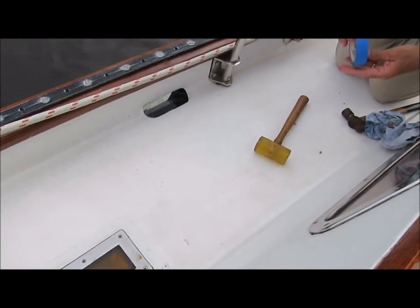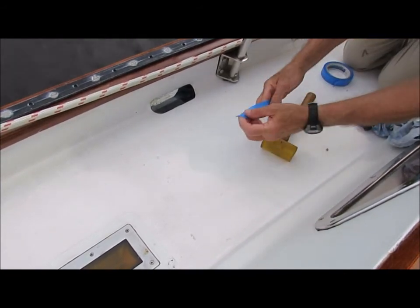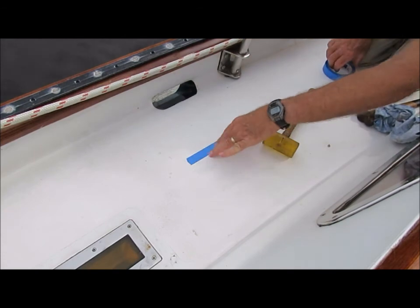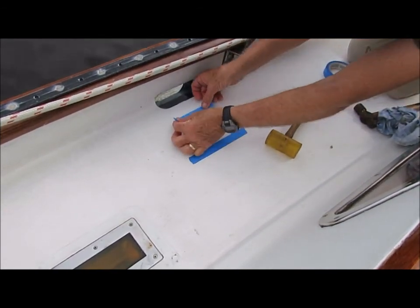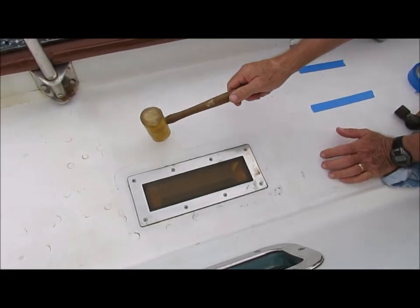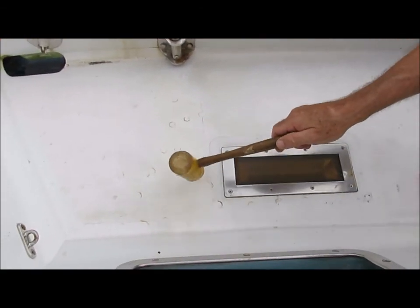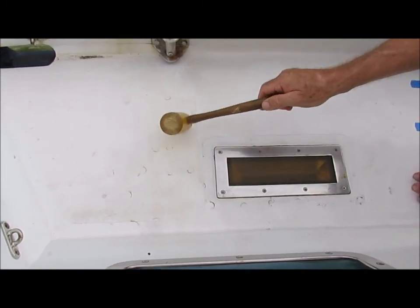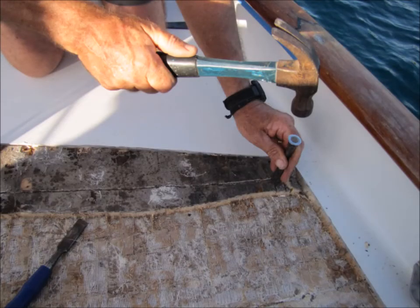When I find a bad section, I'll go over it several times to delineate the problem area. Then I mark the area with masking tape. On Nine of Cups, I found 5 small areas that will need repair. It probably took an hour or so to completely tap the decks of our 45-foot Liberty. In the next video, I'll show you how I remove the top layer of fiberglass and repair the core.